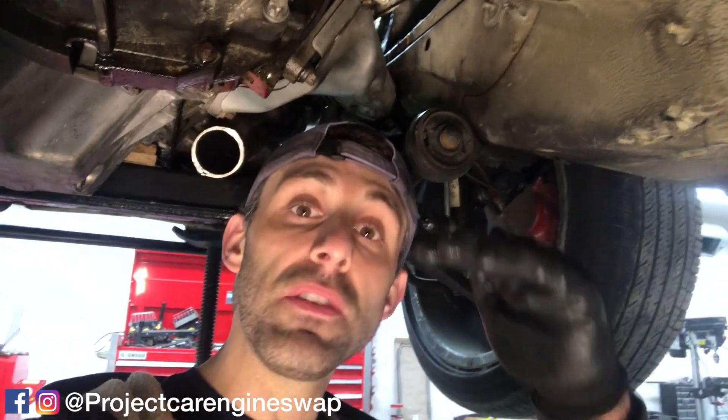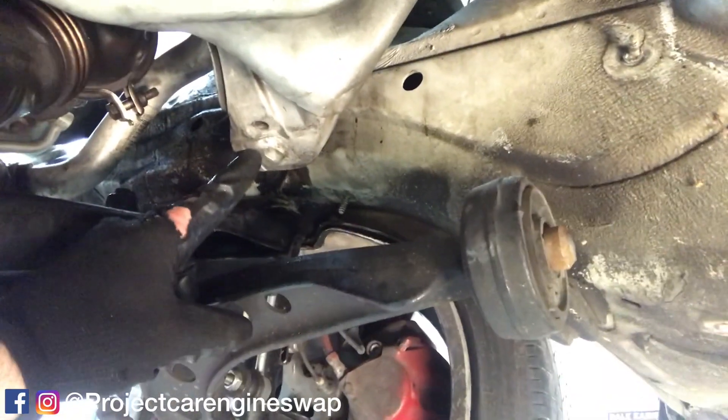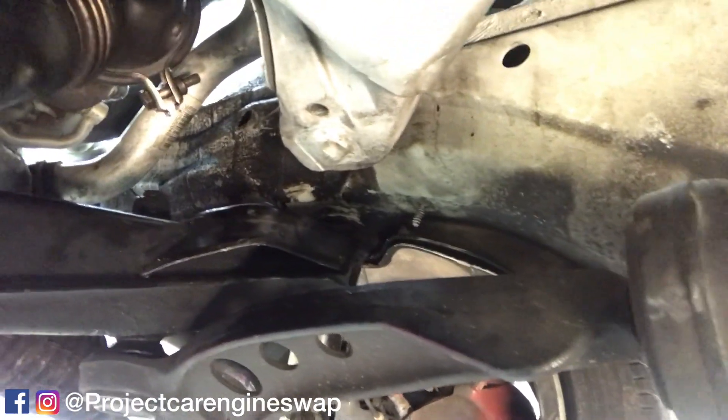This is a very unique mounting position. Because we have twin turbos on the passenger side, those turbos take up room and as a result the engine bracket on the passenger side is mounted a lot lower, and that directly interferes with the position of our mount. So this is not plug and play — this is not use X bracket or Y bracket or X mount. We are going to stick with the stock N54 mount and just adapt the subframe to fit that.